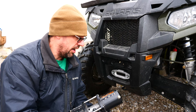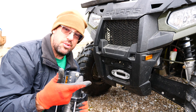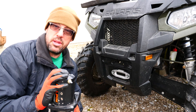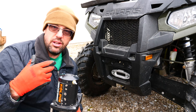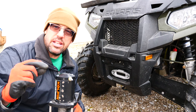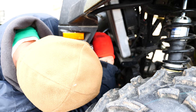That was fun. I wasn't able to drill the stud out, because unbeknownst to me, these are a direct stud that goes directly to the brushes inside and it's soldered on — so there's no way to drill it out. Luckily for me, I had an older Harbor Freight 2500 winch that I have sitting around as a utility winch for when we need to pull things in and out of the trailer. The brushes were a direct match for this Culpin 2500-pound winch, so I saved myself by the hair of my chinny chin chin. Glad I didn't shave yet this week! Let's get this thing slapped back in and then it's going to be time to get the new synthetic rope on.